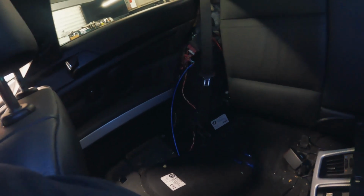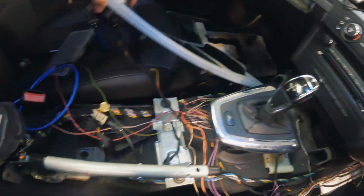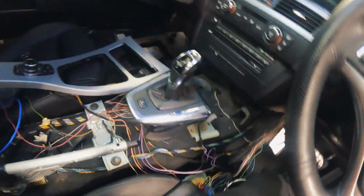I changed that from AJL's, and I'm using this Cat 6 cable for now, and that's just tapped into the PCAN or PT CAN bus at the EKP module, and also the power wire, which is this wire here. It's just powering everything from there. But it's worked. I've got to tidy up all this wiring. I'm going to shorten things and make it look a lot nicer, but I think the wiring's good. But I'm going to end this video off. Actually, we'll go into the house and I'll show you on the wiring what I've done to make this work, because I'm not aware of anyone that's done it or documented doing an MSD80 car without running wires through the firewall, pretty much.